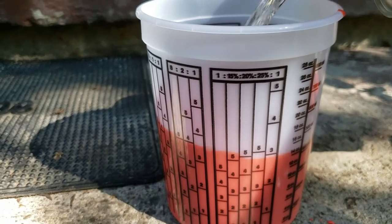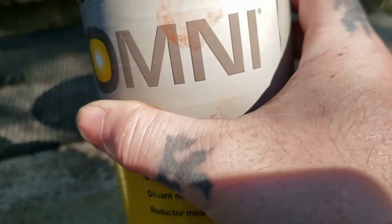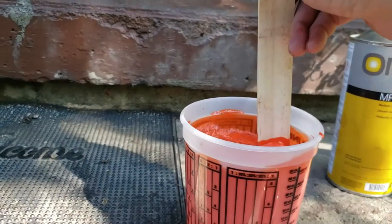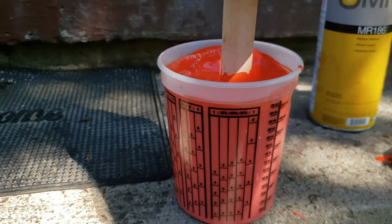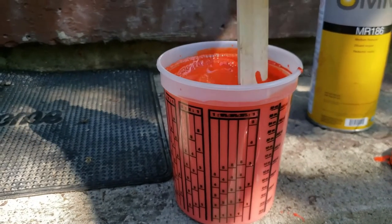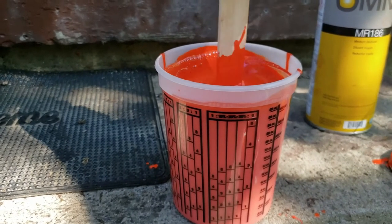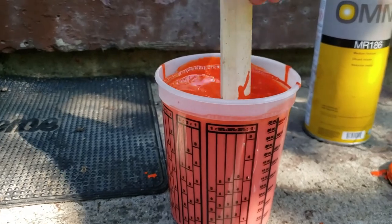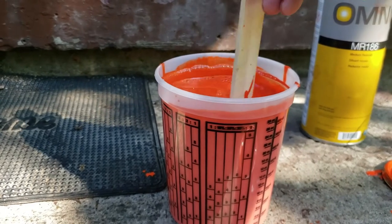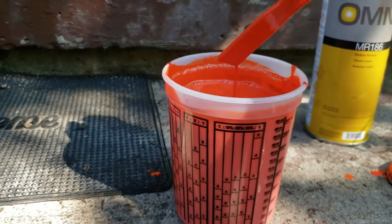We came a little bit above the five mark, so just come a little bit above the five on the other section. Fill it up, and save some to clean your gun out with — keep that in mind. Now mix it and use a strainer to catch dirt or hardened pigments — you can get clumps sometimes, especially if the paint has sat or in cheaper brands. Omni's not too bad about it, Wonder Base kind of is, Martin Senior's not too bad either. Different paints mix at different ratios — this Omni also mixes one to one.